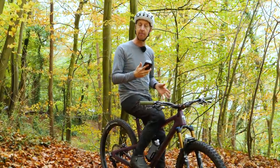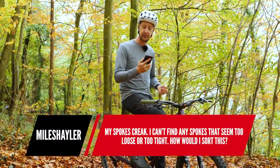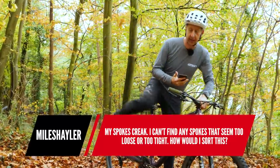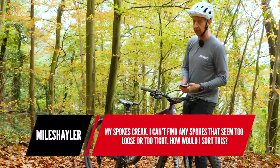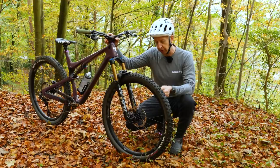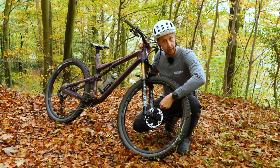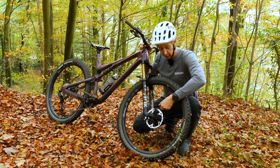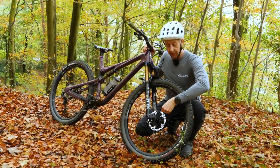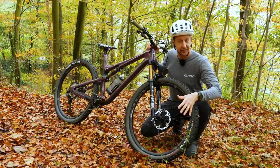First question comes from Myles Shaler: my spokes creak, I can't find any spokes that seem too loose or too tight — how would I sort this out? Let's take a look at what spokes actually do and where some of these problems come from. The obvious one would be the point at which they cross over. You can actually hear these creaking if I manually manipulate that. Just give it a good clean where the crossover points are and it tends to take care of that.